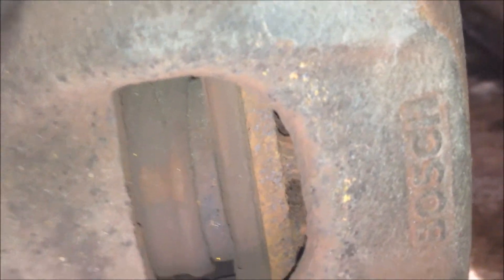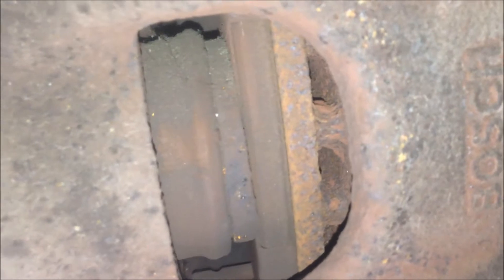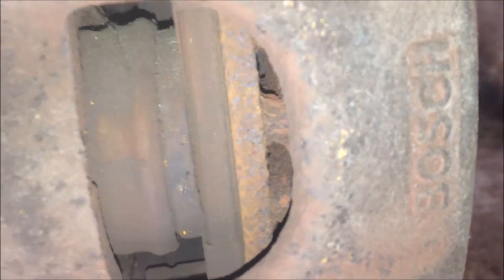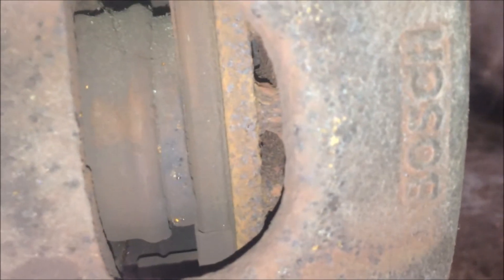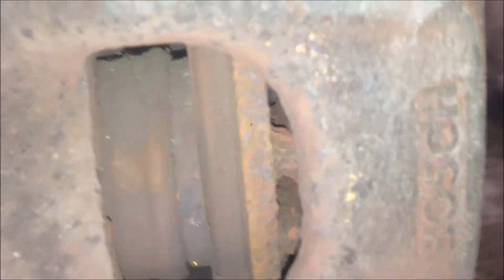So the inner pad — you can see the piston, the back plate, the rotor. And you can't see the friction material nearly. So I think maybe because the disc is also worn, the material may be about 1mm left.